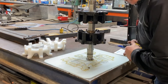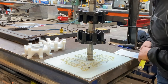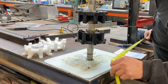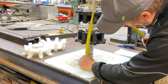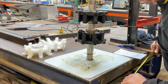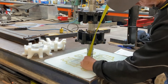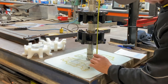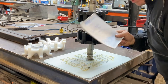When you guys are doing your drivers, some guys will attempt this, some guys won't. If you're not comfortable with it, take it to a shop and get it done. Ken at Mount Magic is awesome at this — he'll do it for you for a small fee. Always measure. Take some measurements of where the drivers are going to be, especially from the end you're going to be putting them on from. That way you can't screw it up. Take some good measurements of where the old ones are, how far apart they are in the track, how far up the other one is. Write them down so that when you're pressing them on, you know what you're doing.